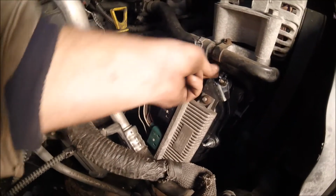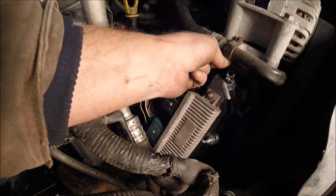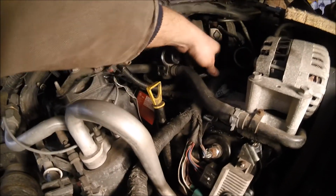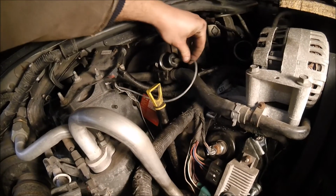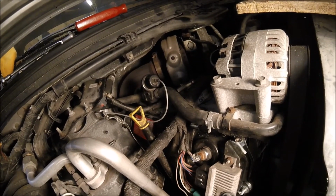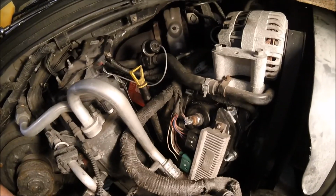And then you can put this harness back on, like all the way down. Clips on there. And then there's one more back here I gotta clip on, and then the glow plugs, once I run, it'll connect in right there. I disconnected this guy. It goes on here. Might have to reroute it, just pushes on. Have to put the glow plug harness in and then start connecting everything back up for the op check.